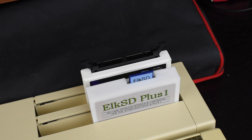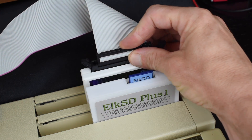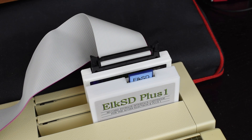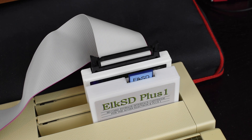The tube is one of the most interesting bits about the Acorn 8-bit series, starting on the BBC Micro, but also being available on the Electron. It lets you attach a second processor, known as the Parasite processor. This does all the main computation, leaving the original one in the Electron to just manage the I/O — screen, keyboard, storage, etc. — and it then becomes known as the I/O or host processor.